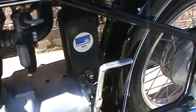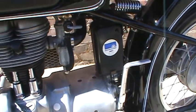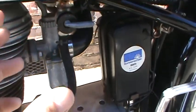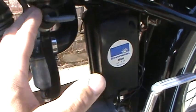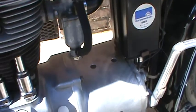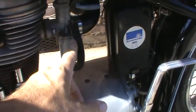I did have to put a new battery in it — I had to source the correct battery, though I do have the other battery that has the Bosch logo on it. I do have the correct fuel petcock; this one on the bike is a later version, not the original, which I also have and is perfect. They were prone to leaking, so at the recommendation of others I put this one on since I plan on riding the bike once in a while. I also replaced the fuel line with the correct one after it had been stored all those years.